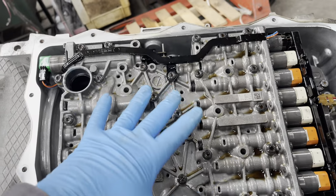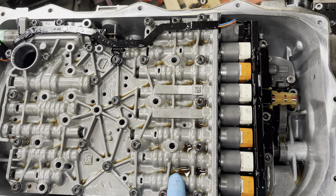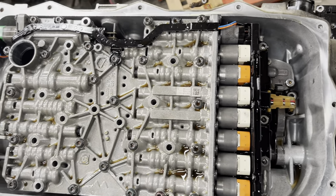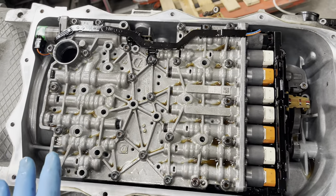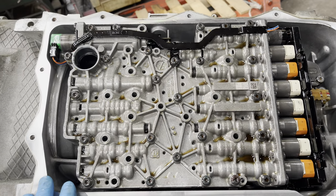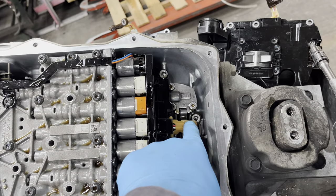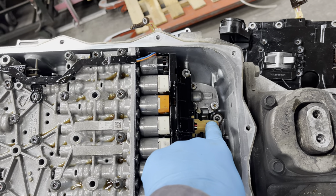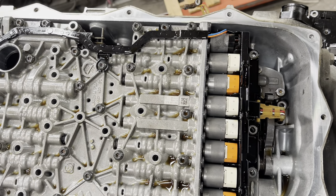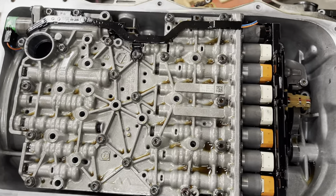Because if it's not torqued properly, it's all kind of not straight and square, and all of these solenoids are getting hung up. These transmissions are not going to shift good. That's why I tell people: put the tray in, drive it, make sure it's good before you take it apart. A lot of guys don't want to do that because it's out, it's here on the bench, got it upside down, you're able to do your adjustments. It's easy to work on because it's not underneath the Jeep dripping on you — I get all that. But when you take these apart and put them back together, you've got to be extremely careful not to torque these down wrong, get this sensor in there wrong, get it crooked or grinding away. We've had five of them in one week where guys have put them in crooked and they've gotten all ground up. So it's just a quick video on the procedure — not exactly a perfect procedure, but highlights of things we've been seeing as a problem.